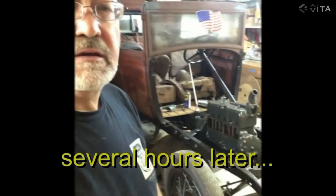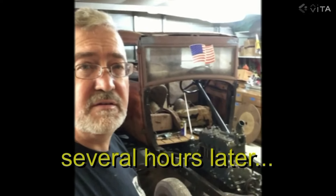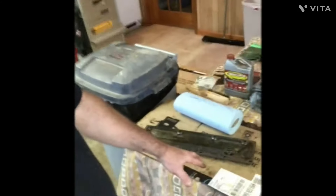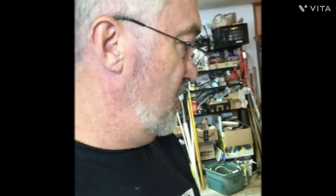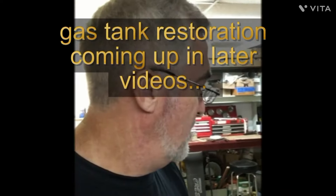That's about it for today. We got the engine to crank over and it actually pumps the oil up, which is nice. We took the side oil cover off and there was lots of rust in there, so I cleaned it up, scraped it out, and put some rust stopper in there. The side oil pan cover was very rusty, so I sanded it really good and put some rust stopper on it too. And don't forget, I still have the gas tank — I sloshed the rust treatment back and forth. We'll look inside that maybe next time and just let it keep soaking. Thanks for watching, and I'll see you next time. Take care.